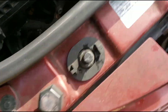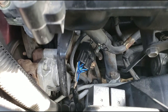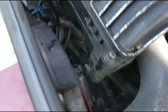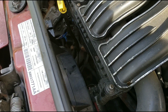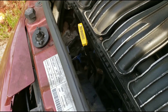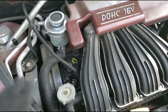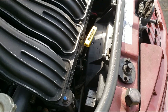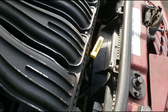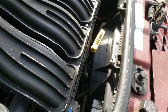I reattached them — it's kind of hard to see down there, but these original ones were not working. I unplugged them and temporarily attached two other ones. As you can hear, the fan is running. A way to check if your fan's running is to put streamers up, or put your AC on high and let it run — that fan will run. The fan's running again, so hopefully my car won't overheat. It was definitely the relays. I didn't have to buy new relays because I recycled the old ones from the original OEM fan.